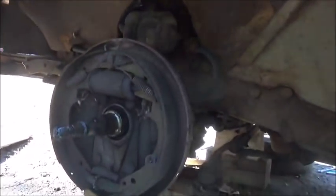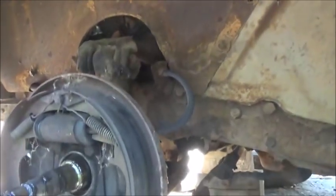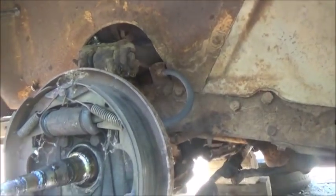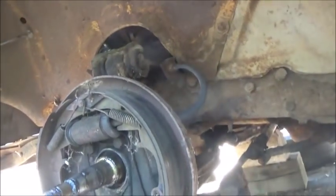The front floorboards don't look bad at all, really. I thought they would look worse than this. And just the rear ones are the really bad ones. I don't see any major issues with anything. Just a lot of cleaning, pressure washing, and getting stuff back together. I think Jordan's going to try to pressure wash inside the wheel wells and everything. We'll get the new wheel cylinders on the front and new hoses. Clean the brake shoes up. Still may turn the drums lightly, or just sand them a little bit to clean them up. And the adjusters weren't stuck. It's just that they stayed dry in there, and I guess that's what saved everything.